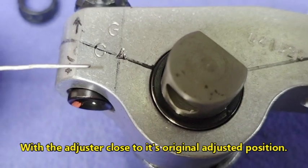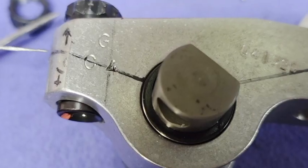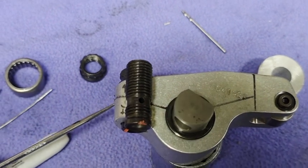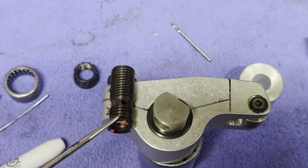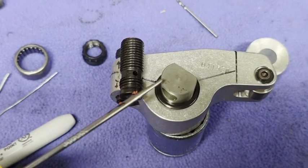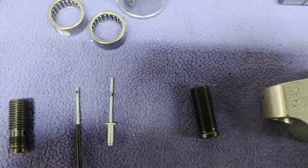The second thing you have to do is bung the end where you've drilled from the outside. I'll lift this up and show you — there's a little bung there. The reason for the bung is there's a chance the oil will migrate up the thread and start coming out the back side. You need all the oil going forward in one direction, so you have to make up a little bung and put it in the end of the rocker.